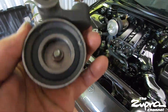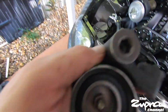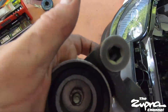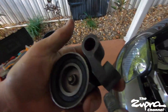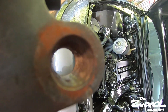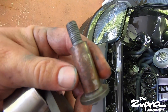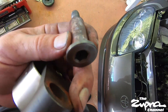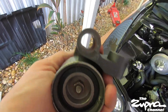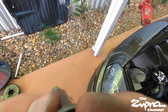Got it out. As you can see, not only is everything pretty dirty in there, check out the bolt. On the way out it was kind of fighting me. Look at all the rust that's built up already. Even the screw - I got a new one - it's not smooth anymore. That corrosion that builds up over time eventually seizes the tensioner from doing the back-and-forth movement it has to do. It will probably stay in the loose position, seize up, and then the belt tries to jump - and that's when you snap the belt.